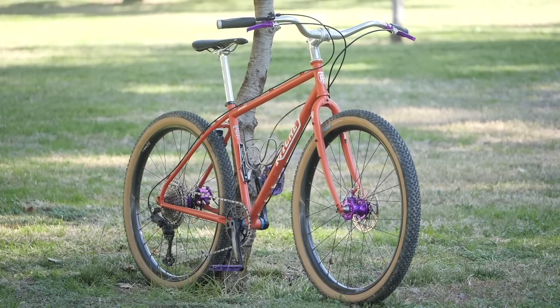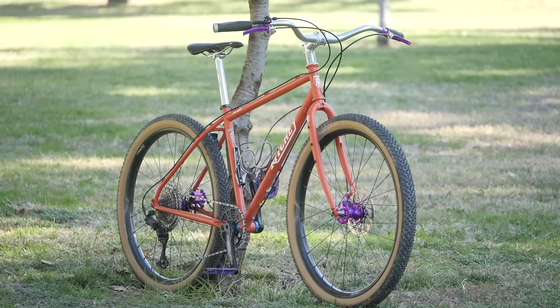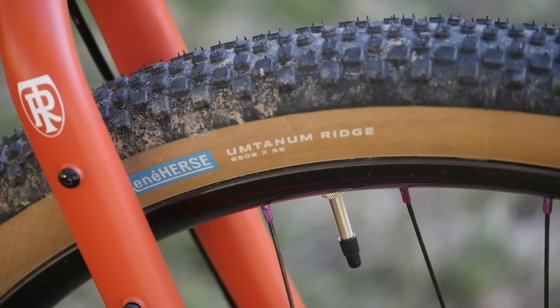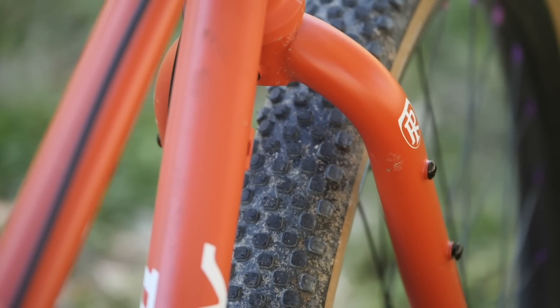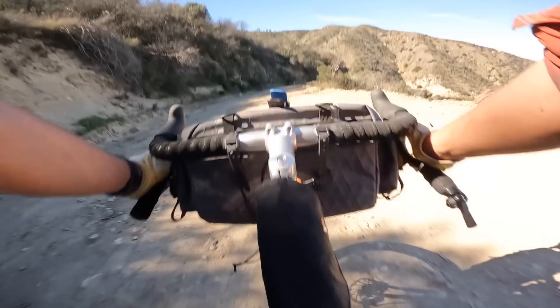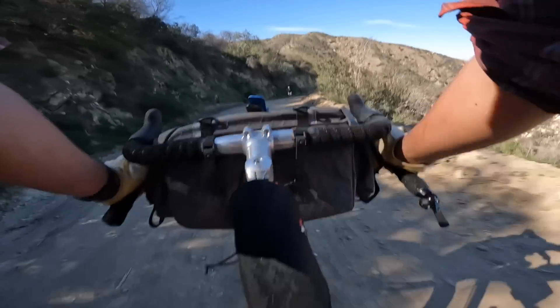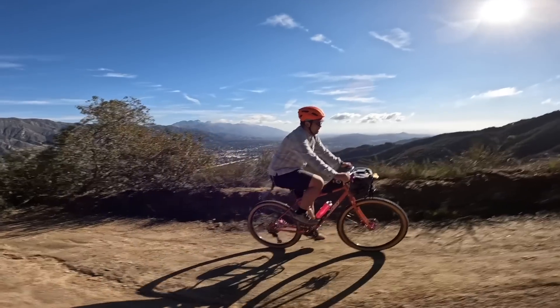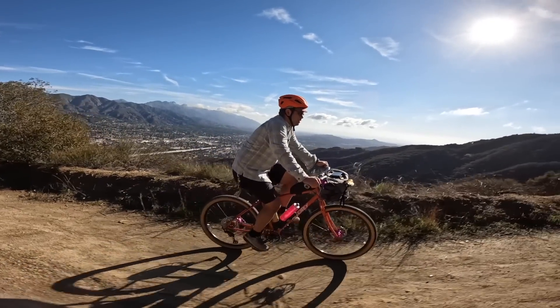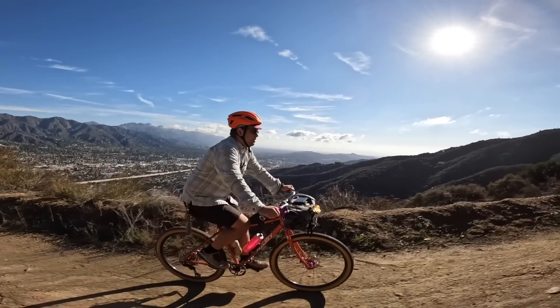In terms of the front end, it's got a 70.5 degree head tube angle. The calculated trail with these tires is 69, but that number is a little deceiving — I feel like it rides like an even higher trail bike. That really comes down to the tires: they're fairly wide, and if you run them at low pressures, there's a stickiness and slight self-centering feel. For me, the bike felt like it had trail in the upper 70s or low 80s, somewhat dependent on tire pressure. Going uphill, the bike is smooth and steady — standing on the pedals, you don't get that jumpy, jerky quick acceleration you'd get with a shorter chainstay bike.